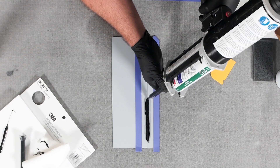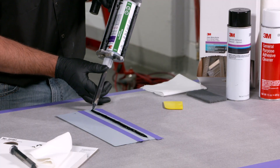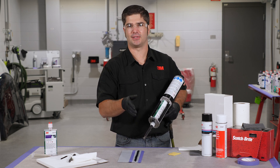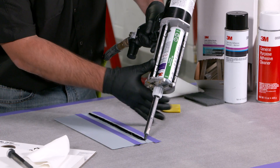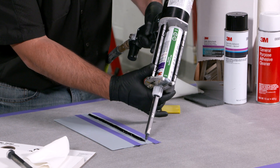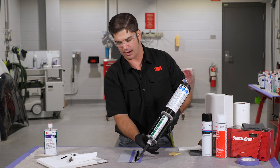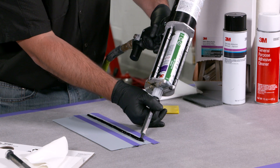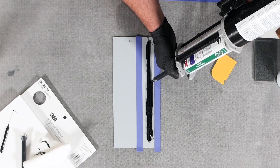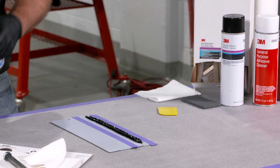You're watching me work it inward towards the seam, making sure that we've got good adhesion to the surface and that the seam is going to be sealed. If I need to put more material in here, I'm gonna go right next to it and work it into itself — we don't want to pull it away or enter air into the material. So we work more material right into itself until we've got enough on the surface to replicate our bead.